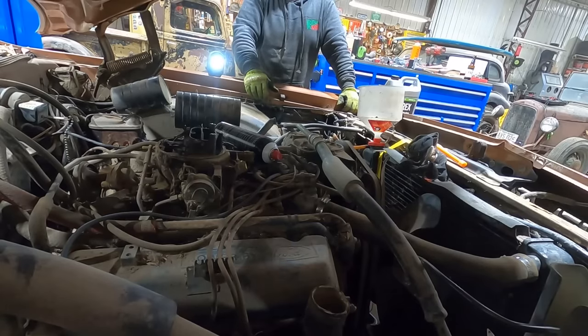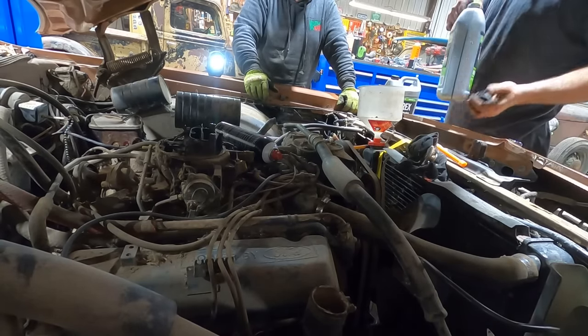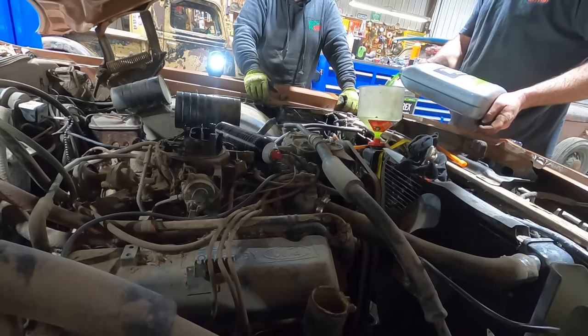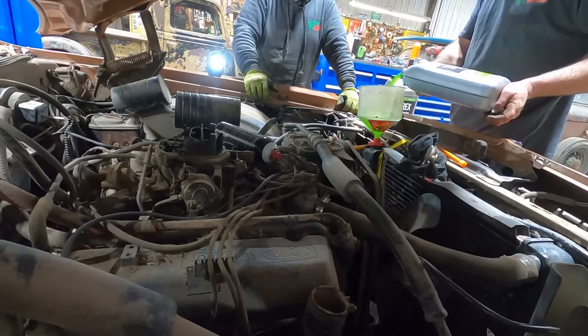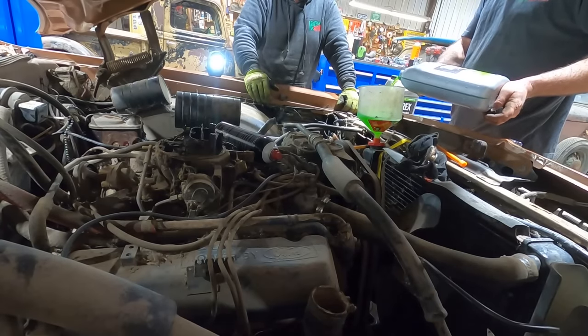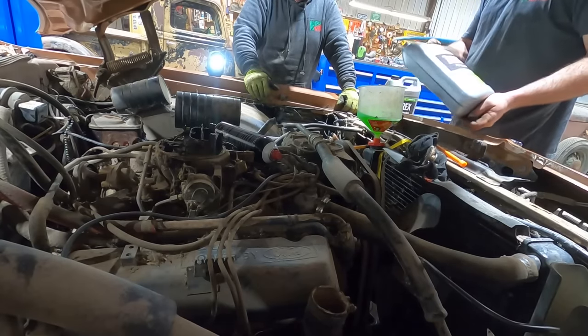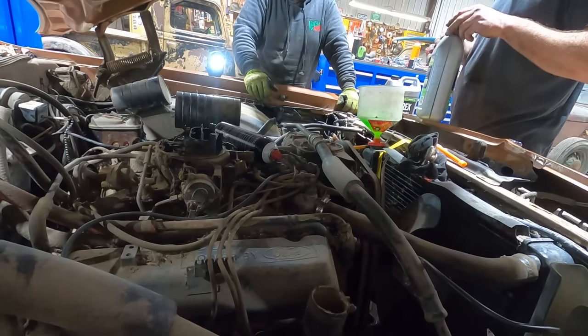I suppose that was probably 2.5 gallons. I suppose they put in it, plus what was ever in the block. So not a real big radiator. Definitely ain't big enough for a 460. We just got it hot to seat the rings. That's the only reason we did that. Mm-hmm. See how much better it runs? Real good. Woo!